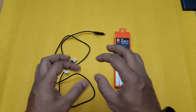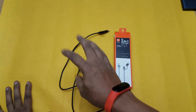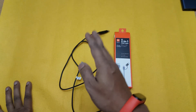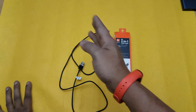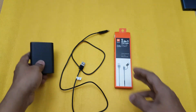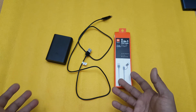So what to expect from this cable: it's best for people who have phones that support up to 27 watts. That covers a lot of phones — most phones support 18 watts, 10 watts, or 22 watts max. Even this power bank is 22.5 watts. Anything in that range, this is an excellent cable — it'll work with everything and it's pretty cheap at 100-and-something rupees.